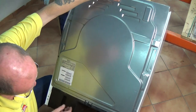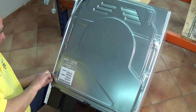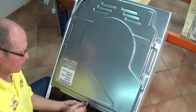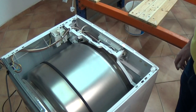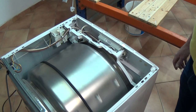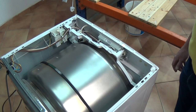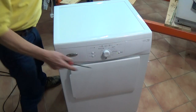When visiting the website you'll find videos on how to change heaters, motors, drum changes and so on, and we also do videos on all domestic appliance repairs. If you've got a reverse action tumble dryer, do let it go both ways before thinking it's finished, just to make sure the belt is lined up perfectly.